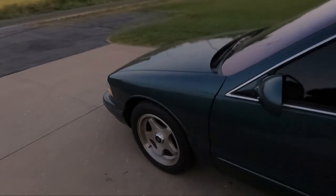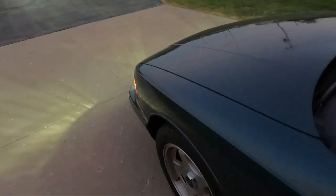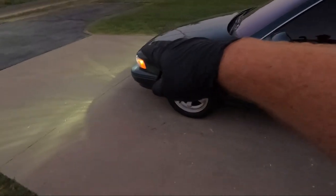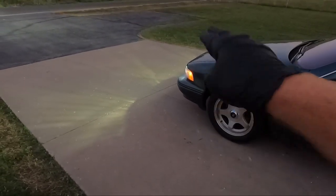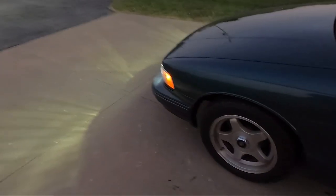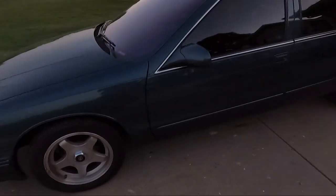We're going to go out and take a look at them about the same time the sun's going down — same time we did this before. Turn them on and take a look. Normally you'd want to be 25 feet away, measure from the middle of your headlight to the ground, subtract 4 inches, and 25 feet away against a flat wall — that's where you want to land. I'm just going to eyeball this one. The driver's side needs to come out towards me, and I think that adjustment would be the inside one.